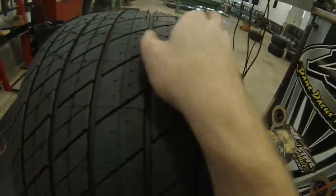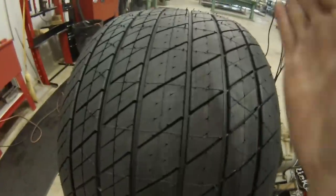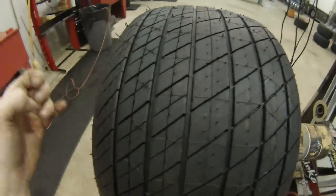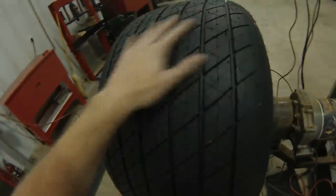The reason I've done less on the inner blocks is because you always get more heat on your inner three right here. You generate more heat and friction here, and less as you go out. So you want to try to maximize these three edges when you get enough max roll and you need all that front grip you can get, especially in the mud.